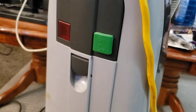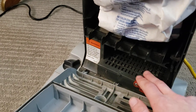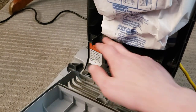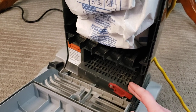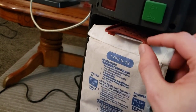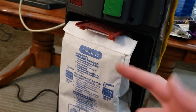The power button is right here. To access the bag, there's a little switch that you simply pull up to get access to the bag and filters. There's a pre-motor filter right here — part of it's missing — and a post-motor filter that goes in right under here, which is also missing. You definitely don't want to run this without the pre-motor filter. There's a nice little bag dock right here — I'm not usually a fan of these bag docks, but this one is actually pretty decent. I always prefer bags that just push on a collar, but this works pretty well too.